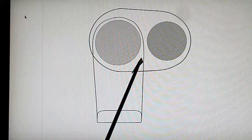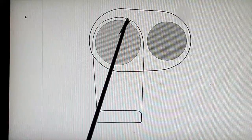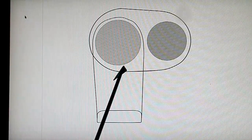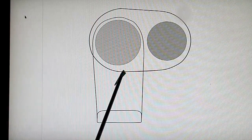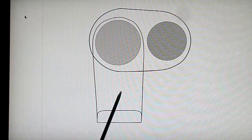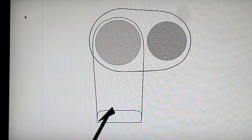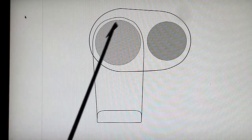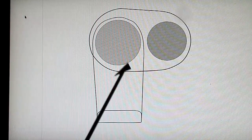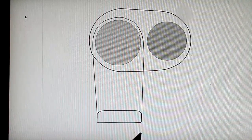Although we got more air coming out of here, there's also a lot coming out of here, and what's coming out of here is just enough to deaden most of the swirl. We've also got flow coming out and going around the short side turn, so it comes out this way in the chamber. All of those moves in terms of reshaping the bowl increased flow, but they also dampened out swirl. So the next thing we've got to do is to find that swirl again.